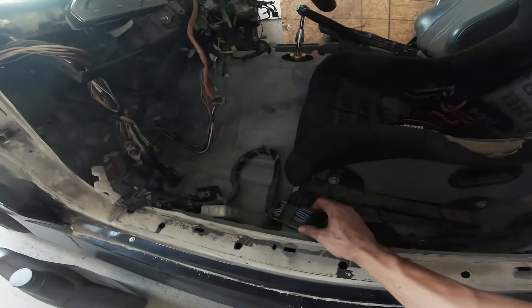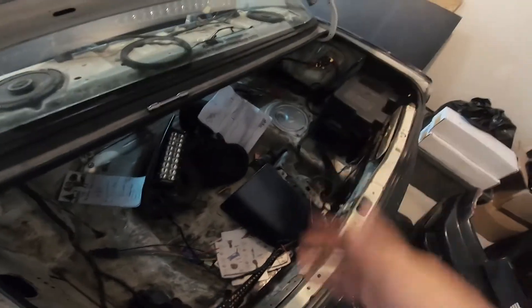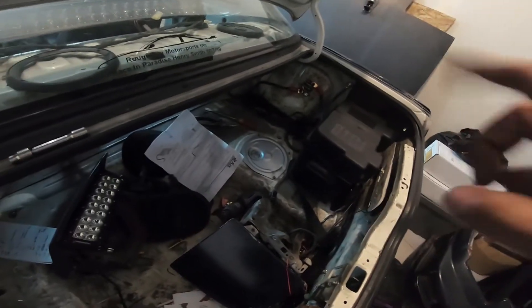I'm on my third harness now. Instead of deciphering what's wrong with mine, I finally just found an OEM one, uncut, plugged into my engine room harness. This is a full five-speed harness, everything's plugged in the same way. I even tried messing with relays and another fuel sending unit — it finally worked and fired up. Battery's working good, the breaker's working.